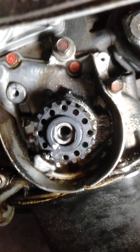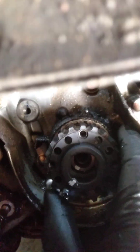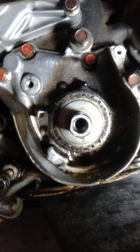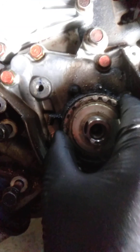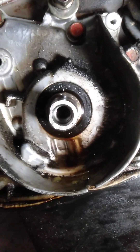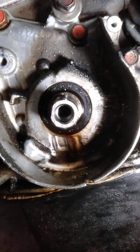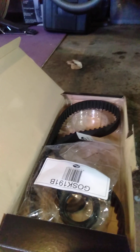For this one I'm also replacing the seals — you'll probably get them in the kit too. I'll remove that gently so I don't disturb anything, as it's been marked. Take that off and the little spinner washer off — there reveals our leaky seal, so that gets replaced too. I'll replace the upper seal as well, as well as the water pump and the timing belt, which comes in this kit here.